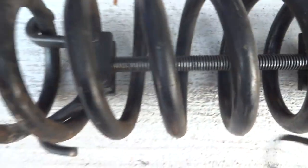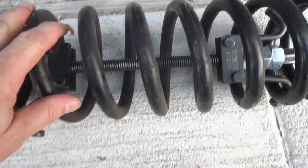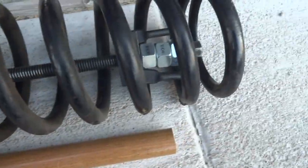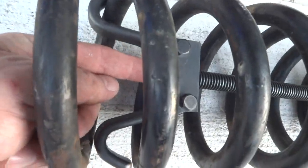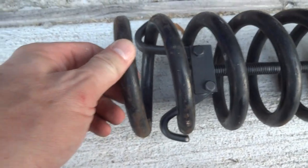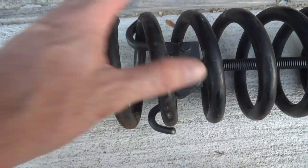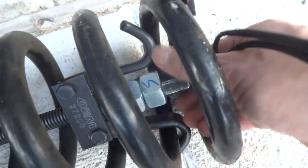As you crank the coil spring screw, it's going to compress the spring, and eventually the bottom of the screw will become lower and lower — more towards the bottom of the coil. In this application I had to compress the coil down to less than 12 inches — this piece of wood is 13 inches, so it was getting compressed probably a good 4 inches. Eventually the screw comes all the way down through the bottom, so when you go to seat the new coil on top of the control arm, the screw has come too low and you can't fit the compressed spring back in.